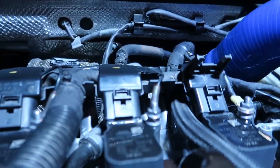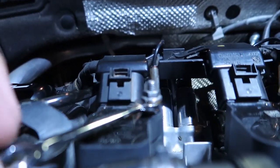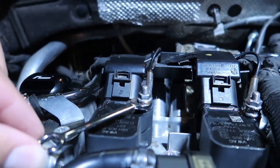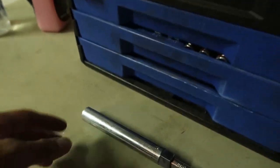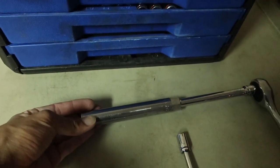Now while we're on the topic of tools, Shop Dap sells this really small, thin 10mm. It's really thin because it's a pain to get these top nuts loose without getting the bottom one loose as well. This fits right under there and holds the bottom nut still while you crack the top one. And Shop Dap also sells this magnetic spark plug removal tool. I'll try and find links to both of those and throw them in the description along with the Precision Race Works tool.